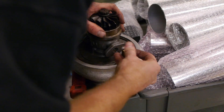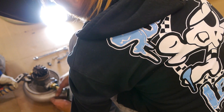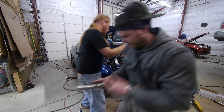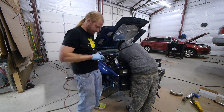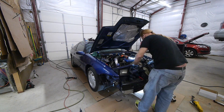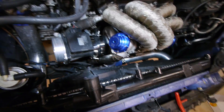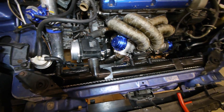Seriously, I felt a little useless here. Anyway, there was a bunch more test fitting to get everything lined up. The turbo had to be reclocked a little bit, the intercooler piping had to be messed with to make it fit, and the radiator wouldn't fit with the way I had the fan set up. Before this I had a full-size stock fan on the passenger side and a slim fan on the driver's side with the TD05 20G setup, and we quickly realized I'm definitely going to need to go with two slim fans — I might even have to go with a pusher setup because I could not fit the full-size fan on the passenger side anymore. It was getting late so I just left the stock one off for now and ran one fan to get it home.